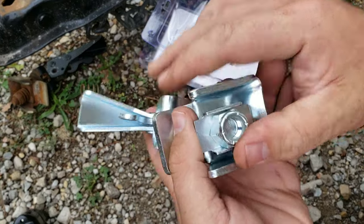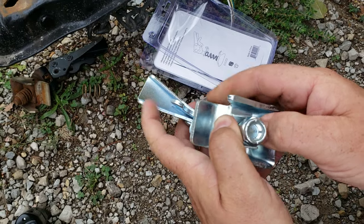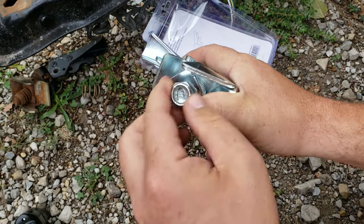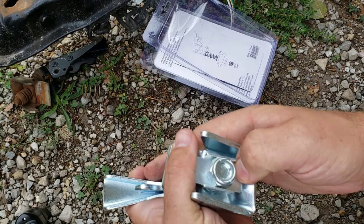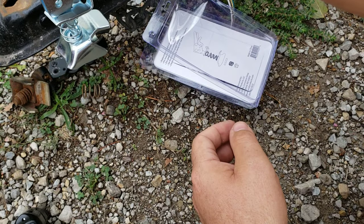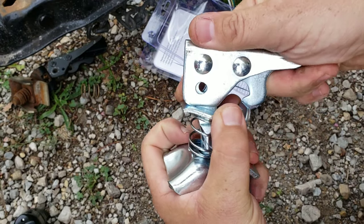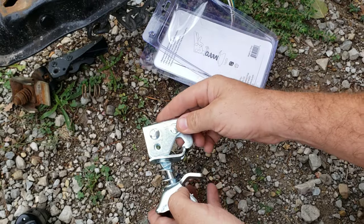On top of that is the plate, and last is the nut that will go on. It has a nylon thread on the inside — make sure that faces the bottom, as that's to help lock it in place. As you can see, the plate will keep the nut from moving. Once you get it on your hitch to tighten it up, simply push down on the spring and tighten the nut. So that's it — when it goes on the trailer, that's how it's going to set the spring and everything else will be on the bottom side. Now I'm going to go ahead and disassemble it and we're going to put it on the trailer.